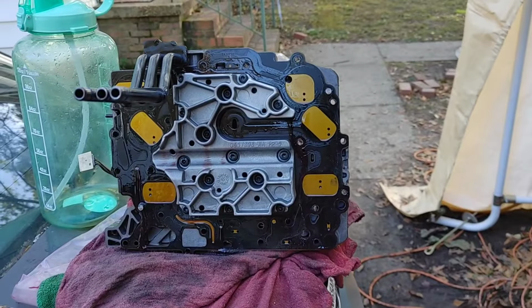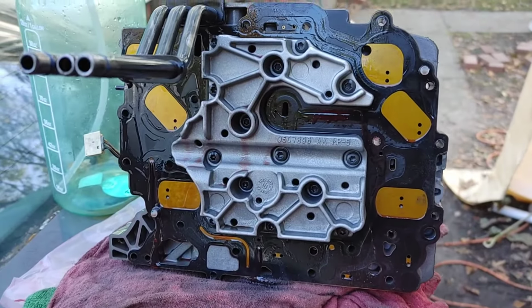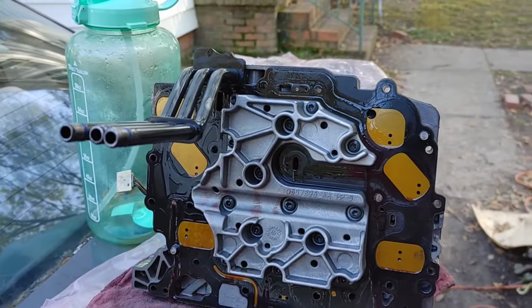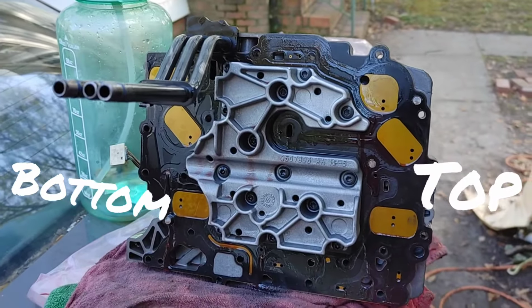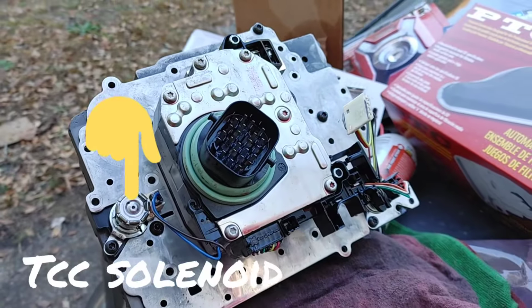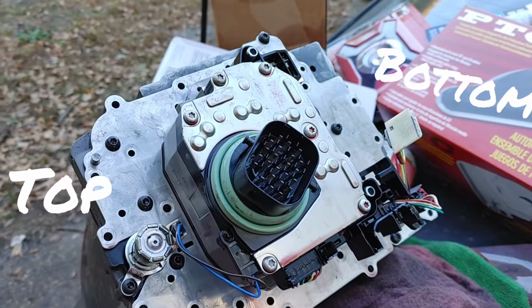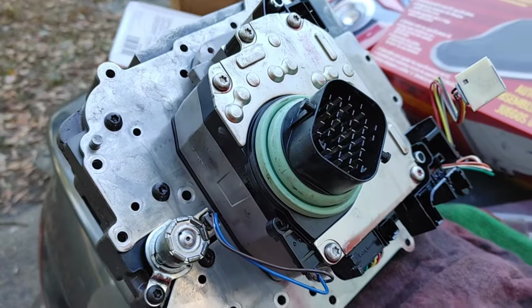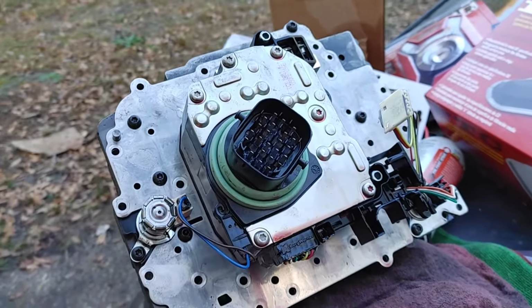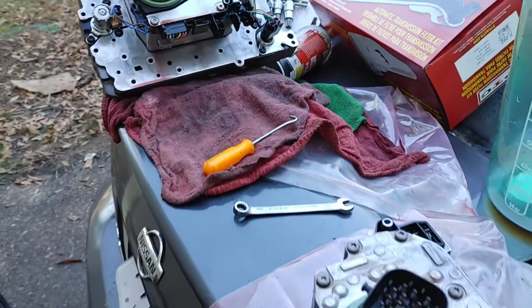The vacuum hoses weren't really hard to actually put back in. Just remember the way that you see them right there in the video is the way that they go back in. The straight parts are at the back, and you can feel it when you make them in. They will have a little bit of a click with the O-rings.